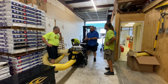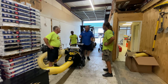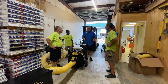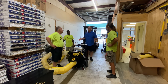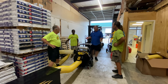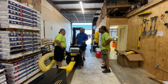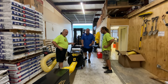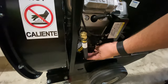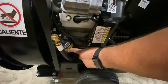Make sure you blow that filter out after every job. Briggs and Stratton says 100 hours for oil changes, Cool Machine says 50 hours — but I have customers saying 30 hours, and 30 hours it is. Oil is cheap, engines are expensive, and downtime is much more expensive than that. We have a nice little oil drain here that's real convenient — it just goes down and drains everything, and your oil filter's right there.